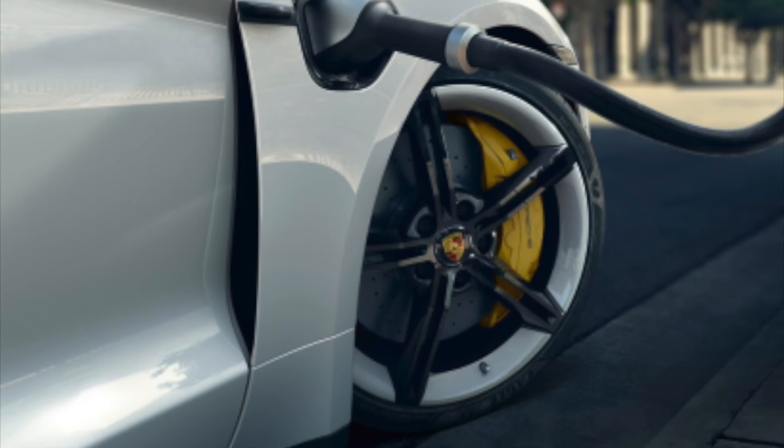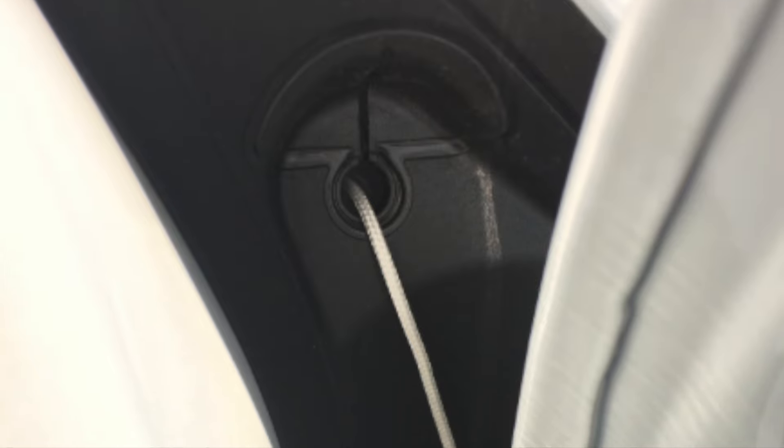Here's what you're gonna do: open the driver door and pull this latch at the top. Once you pull it, you have 20 seconds to go to the charger itself and press the release. It should already be unlocked, but I pressed it anyway, then pulled it out and it worked fine. It does tell you that once you've done this, you should take it to your local Porsche dealer and they should reset the cable.